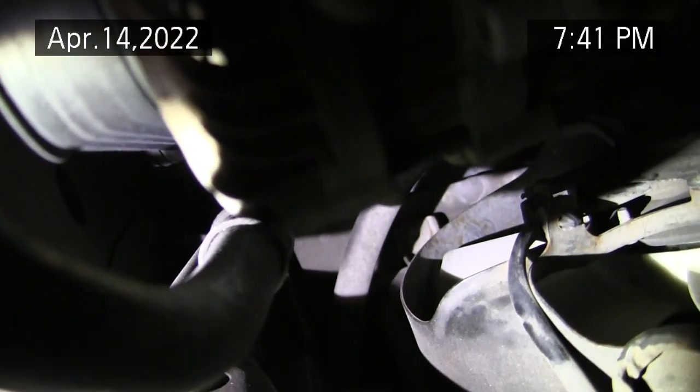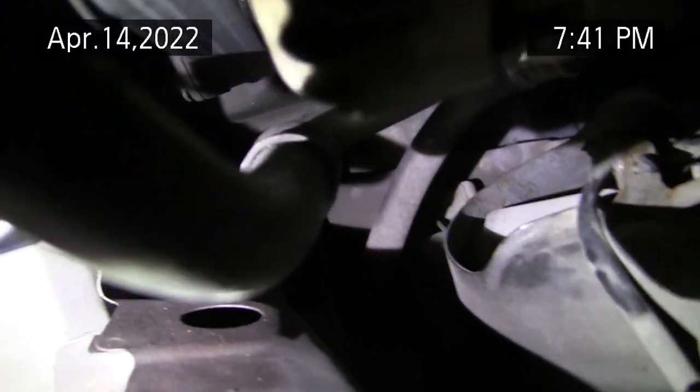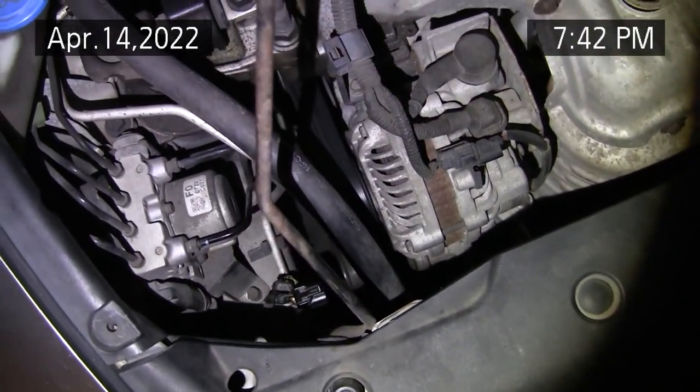But anyway, I think I've got this pressure thing: red, green, and black. Black being ground or negative battery, red being the 5 volts or 4.5 volts, and green being the actual pressure. I thought this switch was like a jumper situation, and it's not. It's an actual voltage going to the computer. I hope there'll be a diagram at the very end of this video that will be helpful. It took me a long time to find it on the internet, but I finally went to hondatech.com and found it. But it was a photograph. It wasn't a PDF or document or anything. It was a photograph. So, thanks for watching.